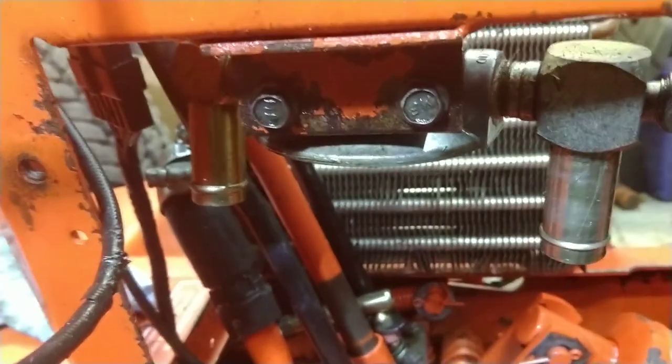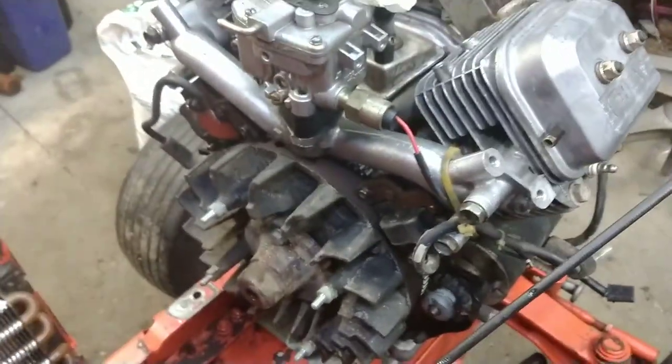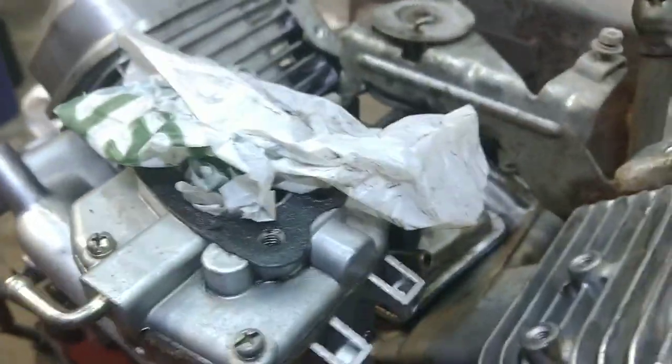Some have the filter, some don't. You can see how much easier it is to access everything when you're starting at the point we are now. Even the engine's out of the way. With this being a leaker, I had to take the tins off the engine completely because all these fins were completely packed with junk — everything around it. All of the valley here was packed, the carburetor, you couldn't even make out the distinguishing features. It was so packed you couldn't actually tell there were coils here — it was so dirty.